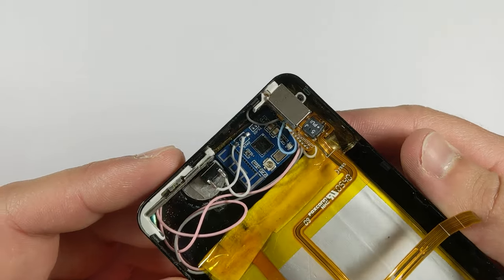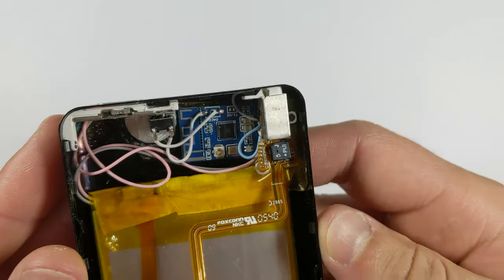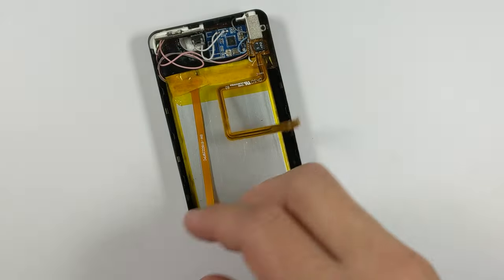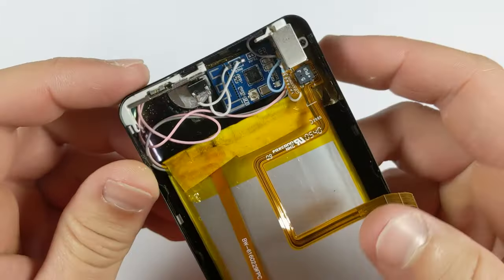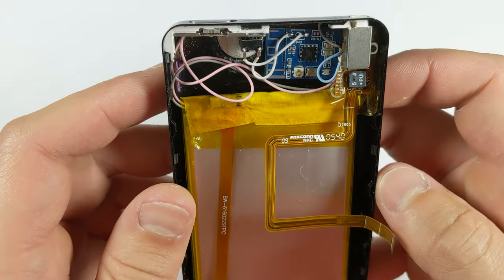What this kit contains is a rear housing with a Bluetooth board on the inside, which is wired to the bottom of the headphone jack. The headphone jack will still work as normal too, by the way. It's powered by a 3000mAh battery, which also doubles as the battery for the iPod. The battery that comes with the iPod was a 650mAh one, so this one's over 4 times bigger, which is necessary as the Bluetooth will drain a bit of extra power when it's being used.